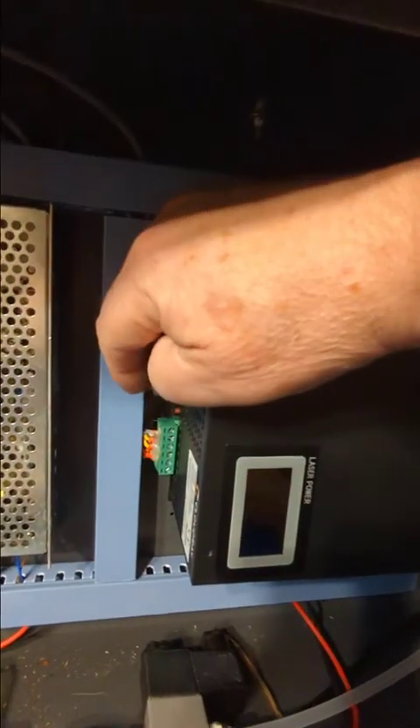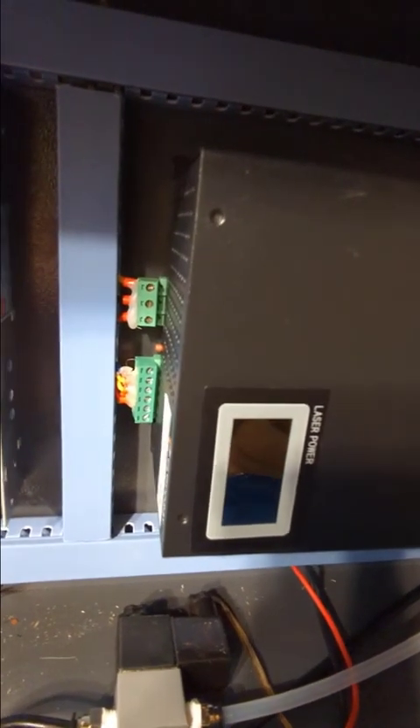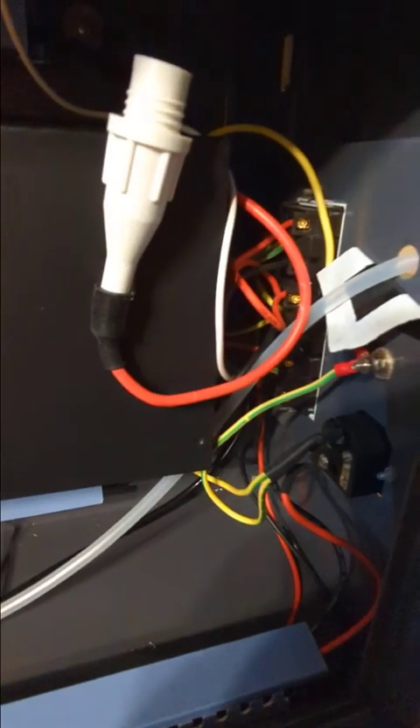Here's the new power supply installed. I simply unplugged the connectors from the old power supply — left the wires all connected — and plugged them into the new power supply as a complete unit. Don't mess with them; they're all hot-glued together and just pop right out. It's just the four screws, and then two wires coming out the other side: the high-voltage wire and the milliamp wire that goes to my ammeter.